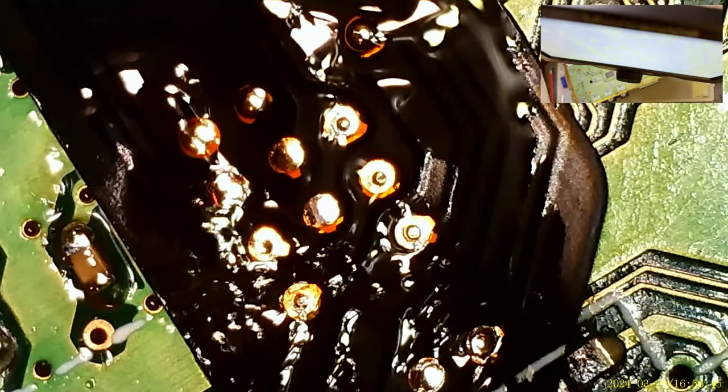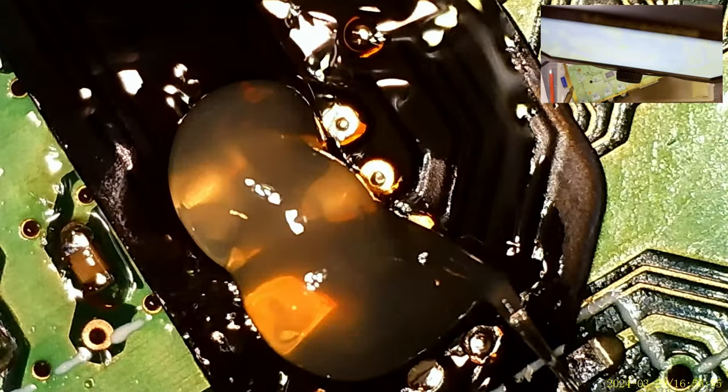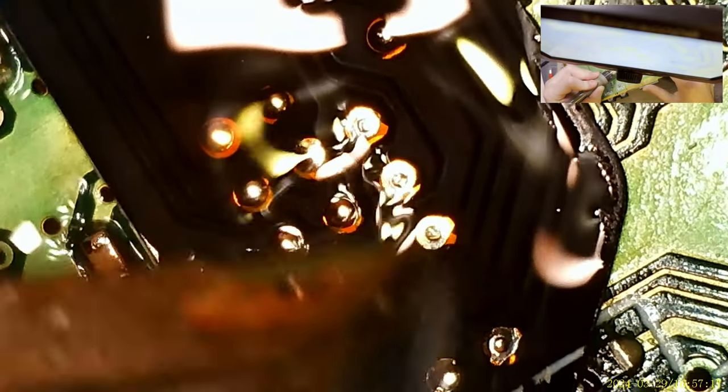I need fresh solder and more spread, though. It's probably fine, but I'd much rather it just work the first try and not have to pull it apart, you know? I'm thinking also maybe the K-tip is not the best for this. I always forget to switch tips before doing surface mount board work, and then I decide to stubbornly try and power my way through it every single time. It's pretty great.